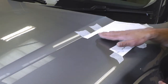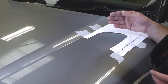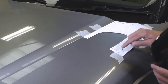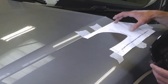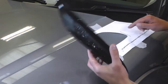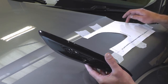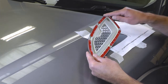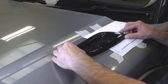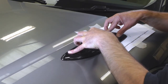Now that I've prepared the surface of the bonnet so that it's clean and free of any grime, grease, and grit — you could just wash it and let it dry and it would be perfectly okay — I went the extra mile and used a bit of panel wipe to make sure we get a good contact. Now, I showed you that I cut out the template and lined it up, but once you've put your template in there you're going to have to take it off in order to peel the film off. So what I've done, as a little trick, is use some gentle masking tape just to hold the template in place. Then you peel off the tape on the back — you'll have to be very careful because you'll only get one shot at this — and then you gently lower that into place once you've taken the tape off and press down and hold so that it stays in place.